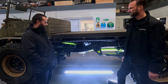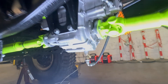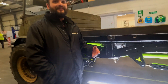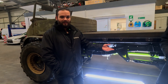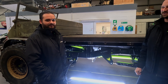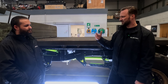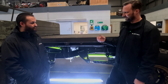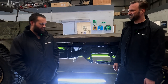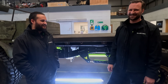The transfer box ended up coming from a Turkish manufacturer. It was very difficult to find one that could handle the torque from the motor. It's four-wheel drive and two-wheel drive selectable, has a PTO, and is two-speed — nearly a 1:1 ratio giving a top speed of around 60 mph, and then a half-ratio split. It's all air-operated along with the diff lockers. Combined with the drive motor and portal reduction, we're looking at around 45,000–50,000 Newton metres at the wheel end, which is why we're worried about the axles.